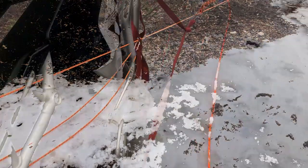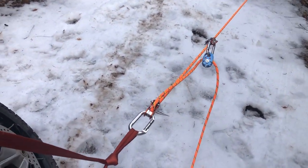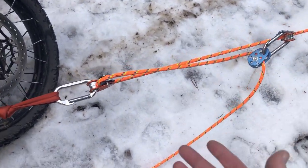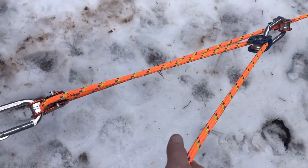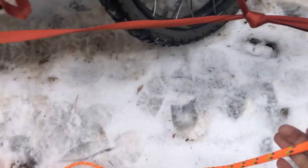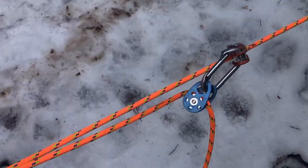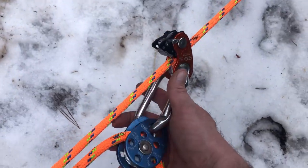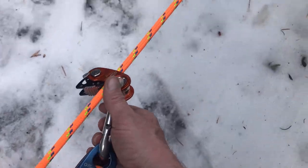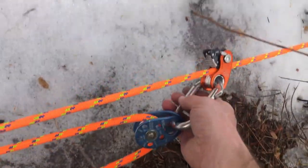See you later. One of the other things, as you make progress, you'll see that these pulleys come together, okay? So once you've gotten them to the point where your pulleys are kind of out of room to come together as you're pulling, you just need to readjust it. So this is all the slack that you've pulled out of the system, and to adjust it and put it right back in, all you've got to do with this type of pulley is just grab the carabiner and slide this thing all the way up as far as you feel like you need to go.